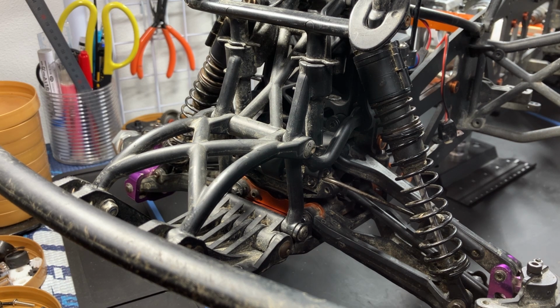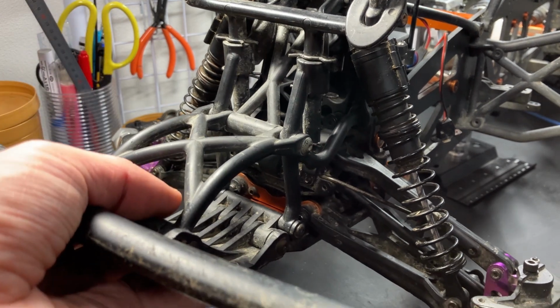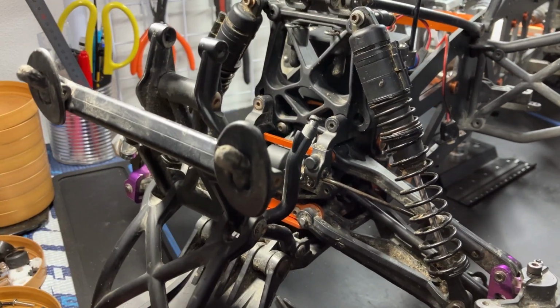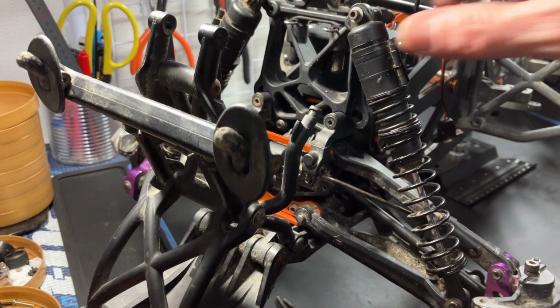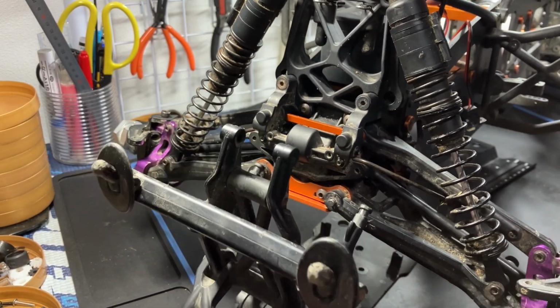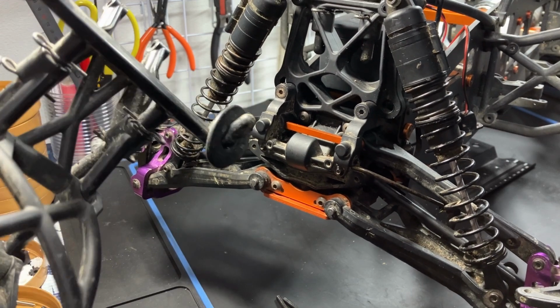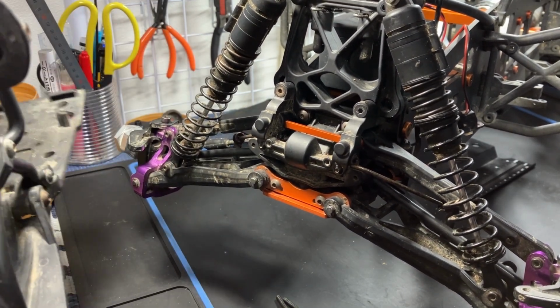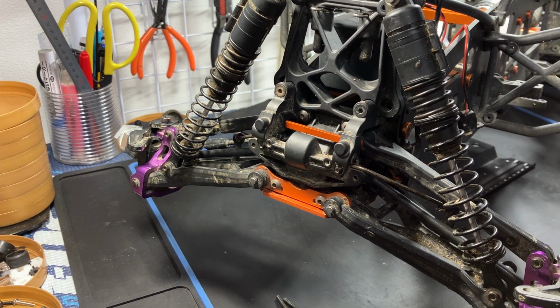Okay, so now I have the clips and screws removed. The front bumper will come off the vehicle in one piece. First, grab the bumper, pull down until they come out, see? And then push down and then push forward and it will come off. This is the front bumper in a complete section. Yeah, so that was 6 screws.